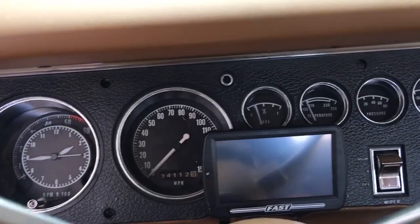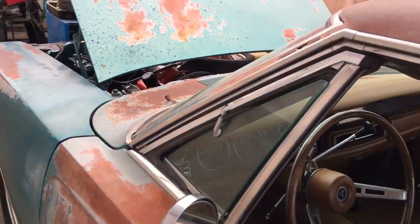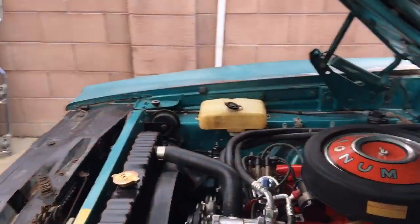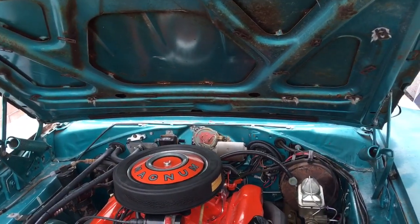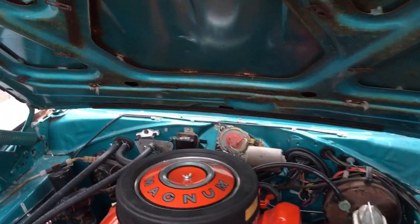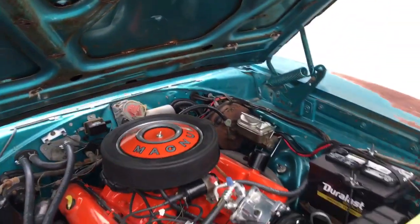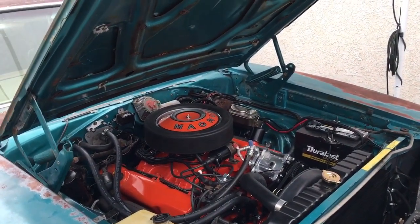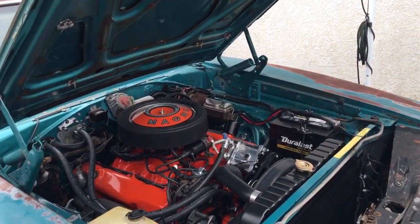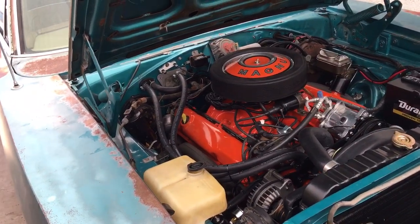When they weighed these from the factory, they were bone dry anyway. So that's going to be more weight added to it right there. It's a 19-gallon gas tank, so 19 gallons divided by 4. What is that? About 4.5 gallons. Usually about 7 pounds per gallon. So that's about, I don't know, we'll just say another 35 pounds. Just roughed it. I suck at doing math off the top of my head, so the guys that want to call me out on it, big deal. Anyways, that's a little bit of weight right there.